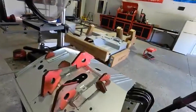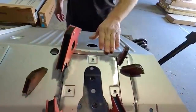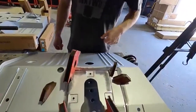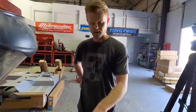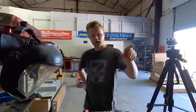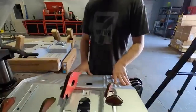This is what we have going on — you can see we've got the inch-and-a-half modification to make some adjustments in here. It's a little high-low but we make those adjustments until it's perfect, throw a couple tacks in, and tweak it after. This fit way better than the last time — I think this is the first time we've ever done the modification before assembling the firewall. We usually do it while the firewall is all assembled. This was originally supposed to have a 302 which requires no modifications, then it got switched to the coyote, so I'm going to throw some tacks on, line up these edges, weld it, and grind it down.